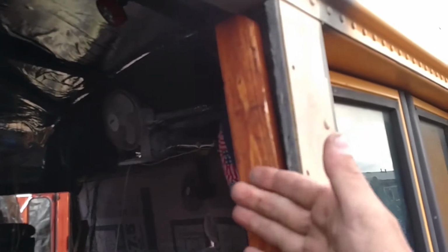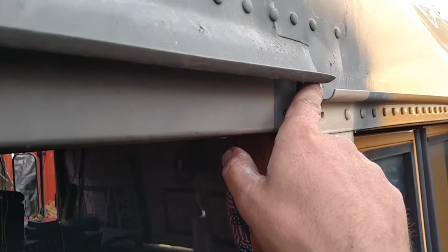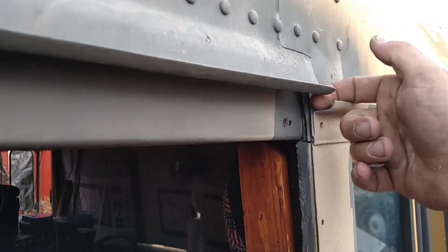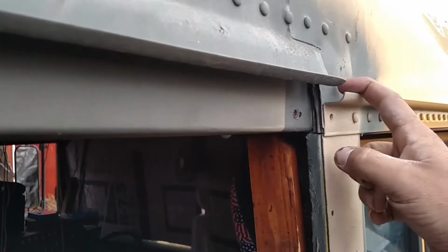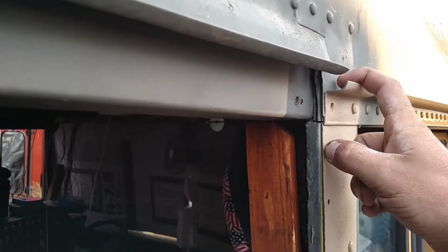So one thing I want to show you, this part of my window, basically I have this rain drainage system right here. And I was first thinking about doing it like these other ones, just measuring it to right here, having my fin stick over. But doing that, the fin would come up and actually hit this. So I would have to notch out my fin and get it to set back in here. And with that being the drainage system, it could leak back behind there. Like I said, these windows aren't cheap, so mutilating them really I didn't feel like was an option for me.